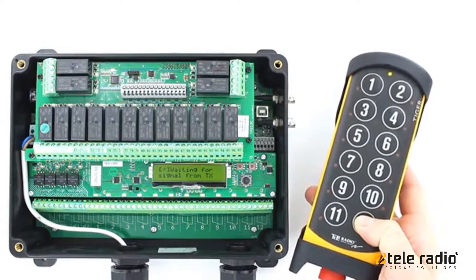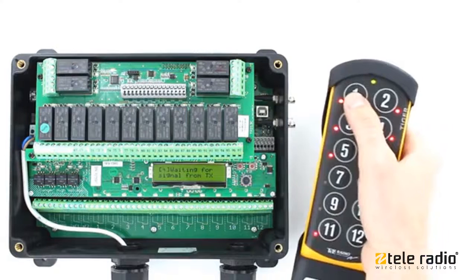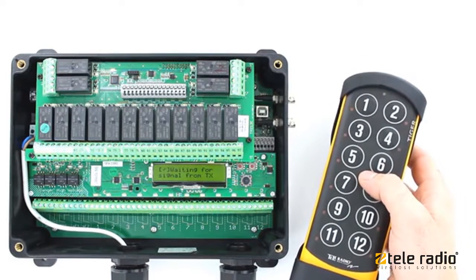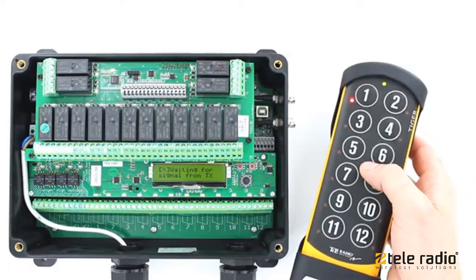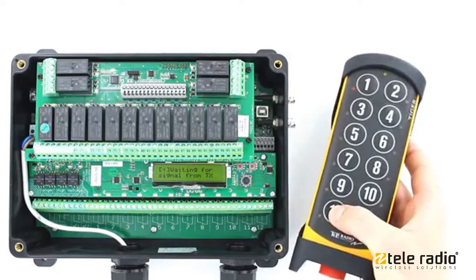Keep pressed. Press the stop button. Press button 1 to enter the registration menu. Press a button on the transmitter to select an empty memory location. Occupied positions are indicated by a steadily lit LED. Press the left start button to confirm.